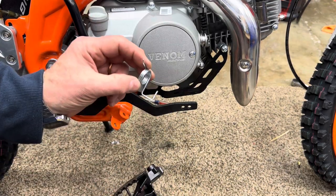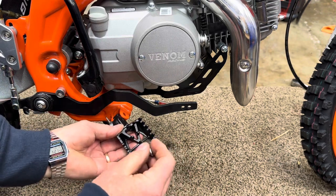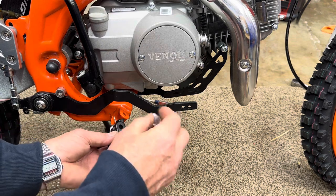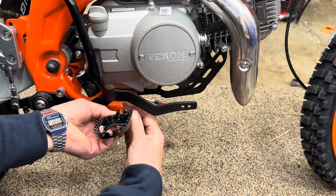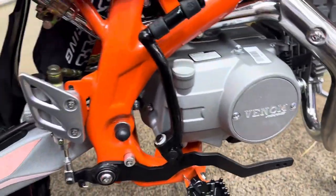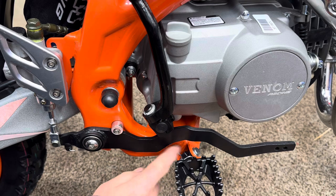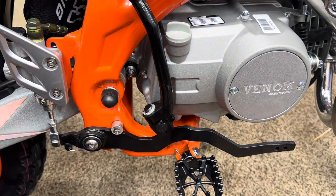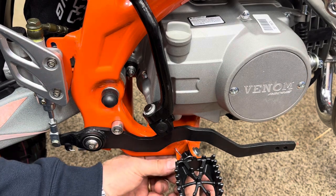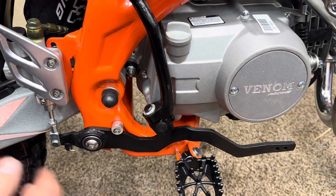We're going to put the peg on it on the right side. We've got the spring that goes over this raised area like this - the fat end goes in there. Then we're going to put this in and drop the pin in it. Let's put a washer on it - probably doesn't need it, but it came with one so let's put one in. Once you get that spring lined up on the weld on the other side, it'll hold it. Then you put your washer and your cotter pin on the bottom, spread it, and just loop it around where it'll stay. And there's your foot peg.